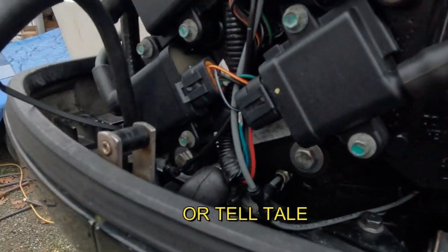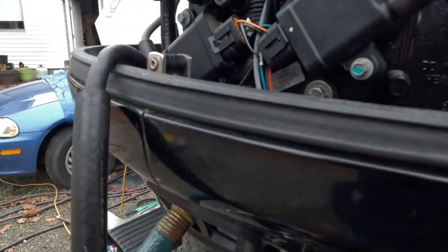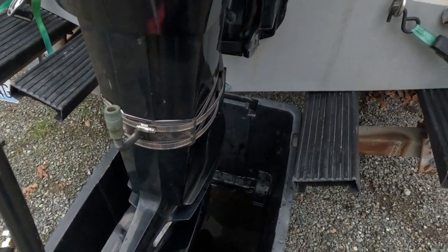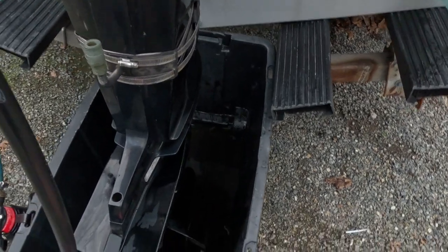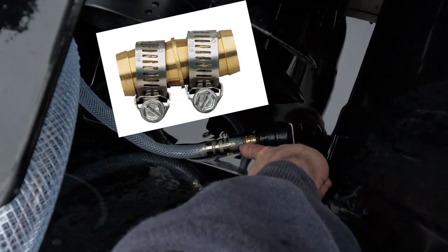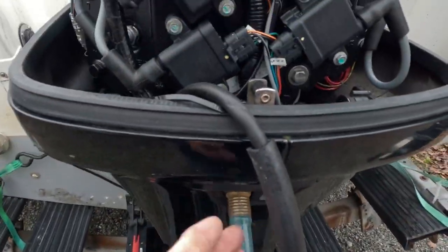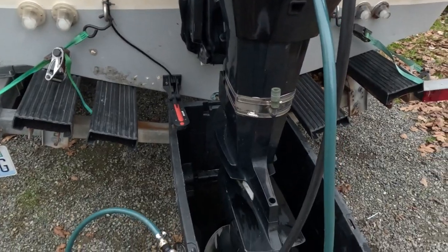Or your hot water drain hole, it's basically an extra layover here. It shoots out here to let you know the water is pumping through your system. That is coming through here and back into our closed loop system. We've got 1 gallon of RYDLYME, 2 gallons of water. We have this at a little bit of an angle, and your pump is down and trimmed your line down into this lower corner here. You can see the splitter I have in the middle of the line that splits this and shortens that to the proper distance for this pump. Then we have this pump going in. It's gonna pump it through the entire system and then back out into the bin and back up. But we have to prime this pump, so let's do that and we can get started.